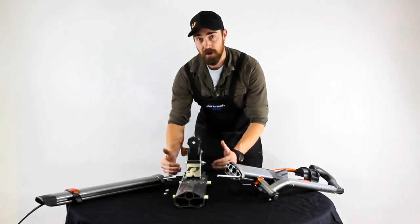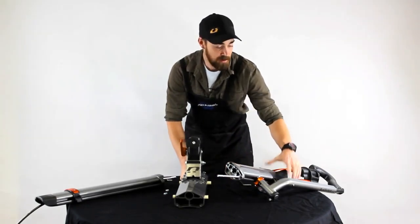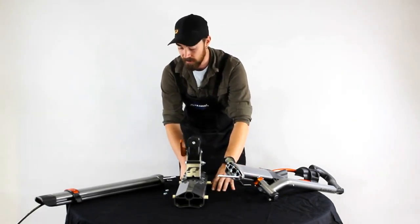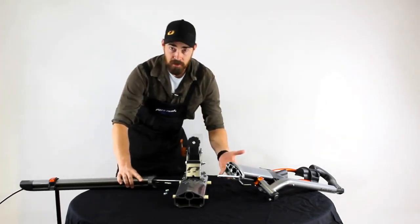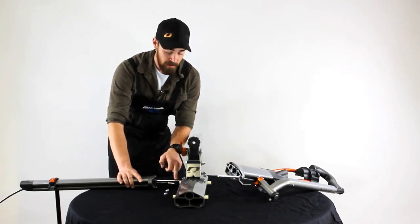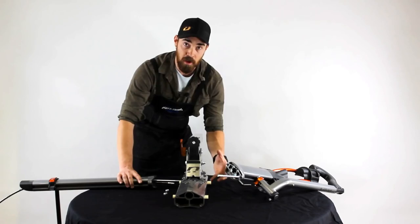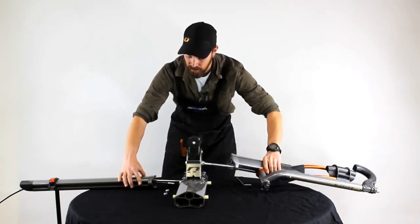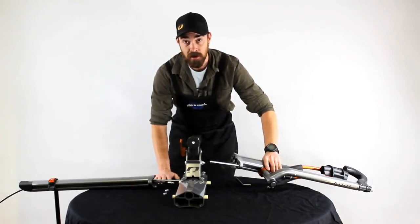We'll start with these 2 closest to that pivot point on the back of the center beam. The front tire scoop with the ratchet arm has that pre-installed bolt. That's the one that you're going to start all the way back here. And then of course the corresponding tray that goes with it. As you bring these up to the center beam, you'll notice that your cable comes through for your cable locks. The cable lock needs to run through that plastic tube that runs through the center beam. Those stay there. They're not part of the packaging, so they need to be with the center beam. As you bring these both up, it works well to put the bolt in, and have the bolt in that one pre-installed, and then we'll slide these in and get going from there.